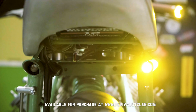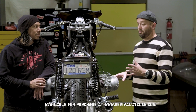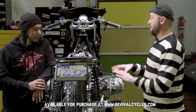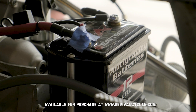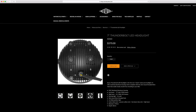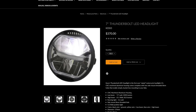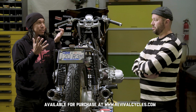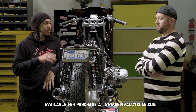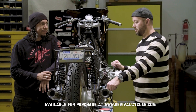On an older vintage bike, the charging system is normally pretty weak — we've talked a lot about charging systems for your electrical system. The headlight, second to your starter, is the biggest draw on your battery and your charging system. So replacing the standard halogen headlight with an LED headlight is an easy upgrade. Look on our website — there's some stuff to choose from. Almost any headlight you want, you can find an LED replacement to go in your factory filament-style halogen headlight.